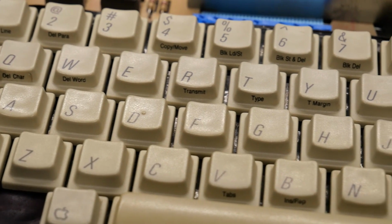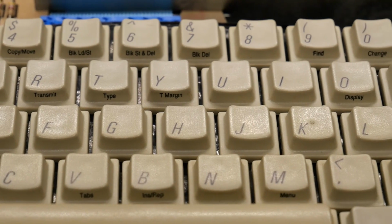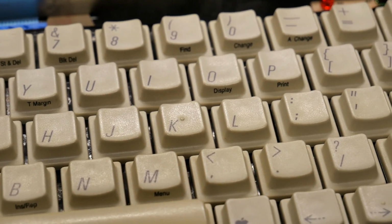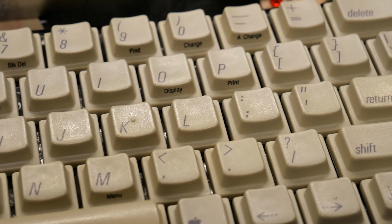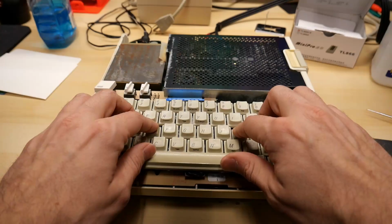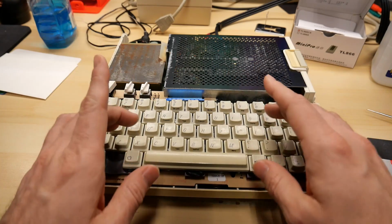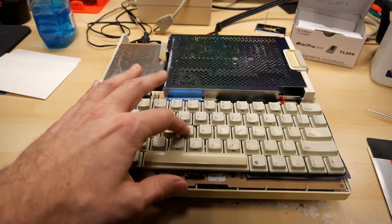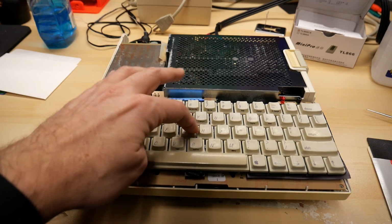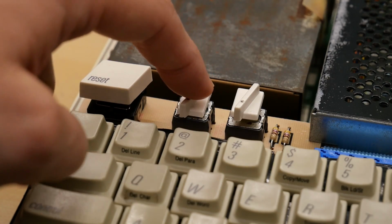And I will have to answer that with a no. I don't think the dishwasher made this keyboard worse in any way. In fact, I think it really did remove some of the scratchiness. The biggest effect on this keyboard was actually the Deoxit. All the keys were working, but it removed all the binding that was going on and the unevenness in the tactility. And I mean unevenness where some keys were really quite hard to push down, and if you didn't push them quite on the middle, it really bound up. The Deoxit is what got rid of that, and not the dishwasher.